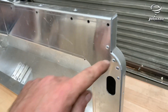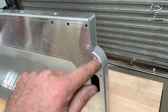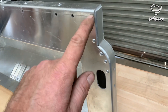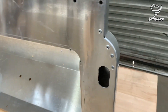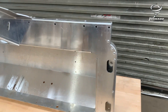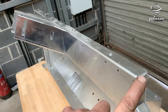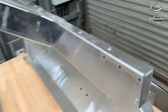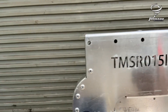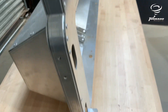As you can see, you just have to manually curve this and it's cut out between all the bends. When it's fully closed up like that it's right — just fold that one out and get these holes to align. You shouldn't have to drill those holes; if you fiddle it right it'll self-align. You might have to just file slightly these corners so it sits high enough. I just had to play with this one to make it fit nicely, because you want that top hole to be perfect for when you put the rest of it in.